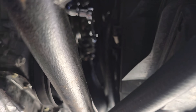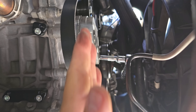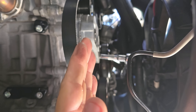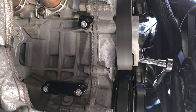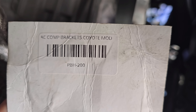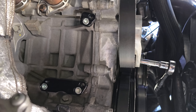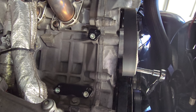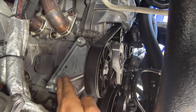I hit a roadblock: when I installed the AC delete bracket, I noticed the belt was riding on the outside lip and wasn't centered on the pulley. I mentioned that to Jake and he said he actually has a bracket for that — PBH part number PBH-200 — which brings the bracket forward based on some locating holes, just enough to center the belt properly.